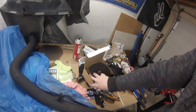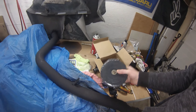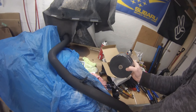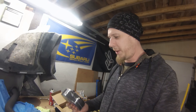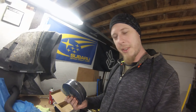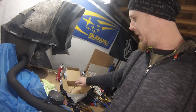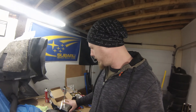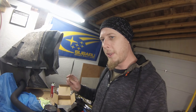The next step after painting is some heat wrap. I'm not the biggest fan of putting this stuff on but it's not difficult to do. From my experience and my buddies who've done it, we just soak it for a little bit — it makes it more malleable, easier to stretch, and then as it dries it shrinks up and tightens a little more. It comes with all the stainless straps, so I won't need to find separate clamps. There are two full rolls and five straps, so ten total.